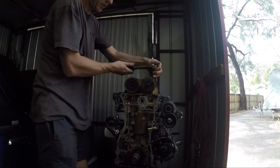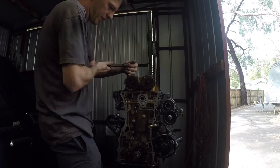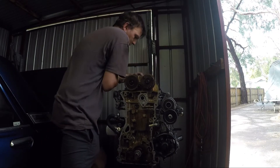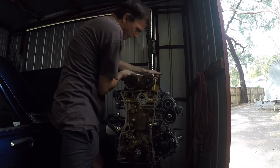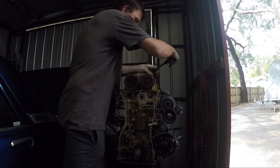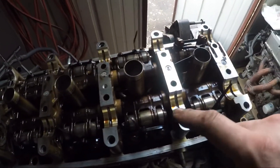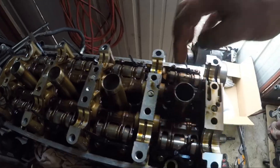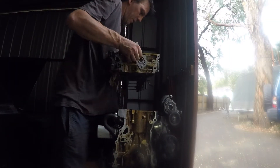I need a long socket for these — I've got myself a long socket now, which makes it easy. They kind of sound like a bottle of a drink opening or something. Some of them have got pressure in them. Between the rockers that control the high cam and the low cam, there's little pins. I've just installed these cable ties on the rockers to stop them coming apart. You still have to be a bit careful, but this seems like a good method.